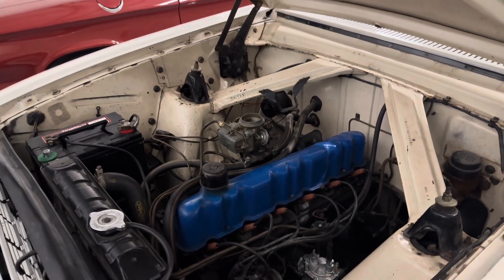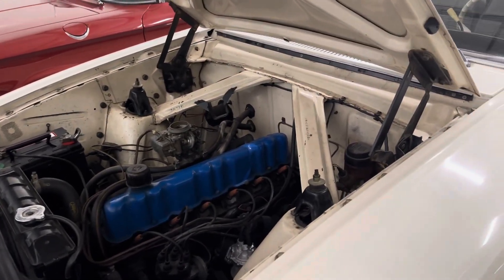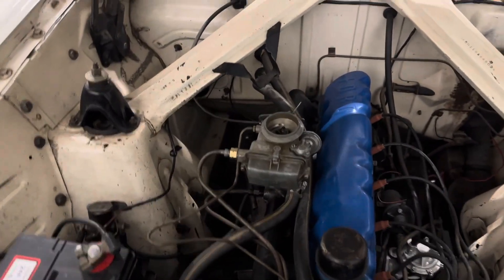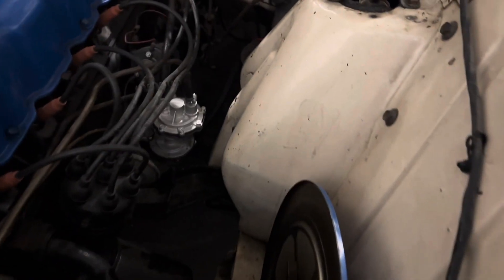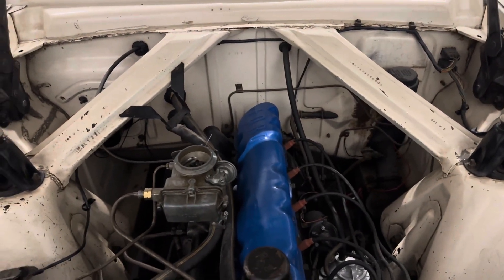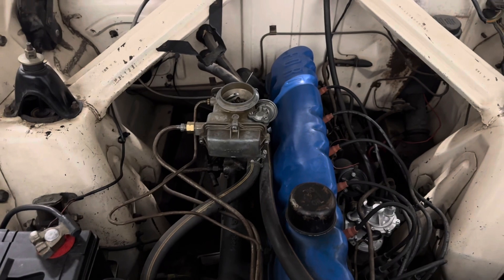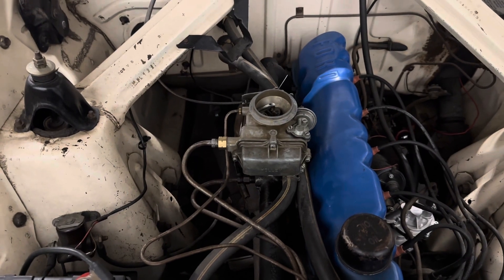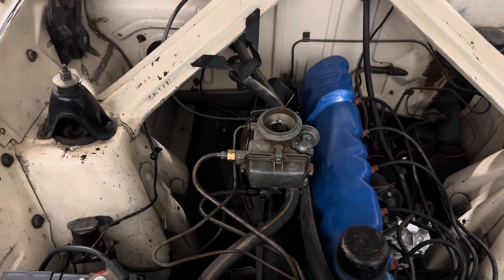Back here on Brad's Falcon — nice little '62 Falcon. Everybody knows we've done a lot on this before. We rebuilt this carb a couple years ago, a year and a half, two years ago. We've changed fuel pumps — I know they've put a few pumps on this thing. She just never wants to run consistently well, and we're curious if this has some casting porosity, as most Ford/Holley carbs always end up having from what we've seen.